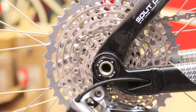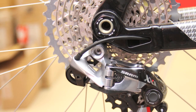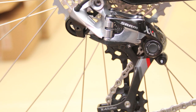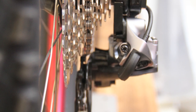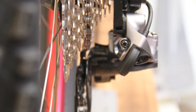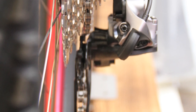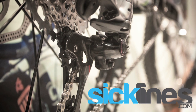We also wanted to focus on the chain management system, so we've changed the rear derailleur. We've kept the clutch — the Type 2 clutch with the one-way roller bearing — to dampen any chain movement. But we've actually changed the derailleur into a straight parallelogram. With other rear derailleurs there's an angled parallelogram to follow the contour of the cassette, but we found that on big hits and vertical impacts you get movement in the rear derailleur. The straight parallelogram shifts directly horizontal, so when you put force on the top it doesn't move — that's one of the big benefits.